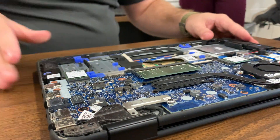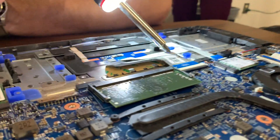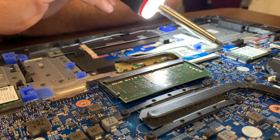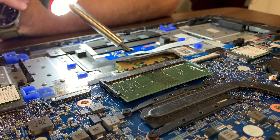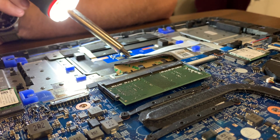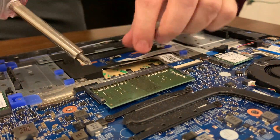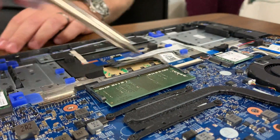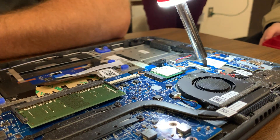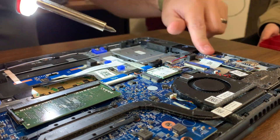There are several ribbons here. This ribbon goes to your trackpad — the ribbons are labeled, so this one says MD and down here says TP. You can guess what those mean. This cord goes to the keyboard — it doesn't have a separate label because it's actually attached to the keyboard. Over here you have the IO and your motherboard — IO is your on/off switch, but this is actually called a daughterboard.